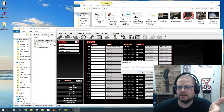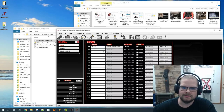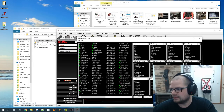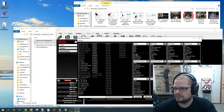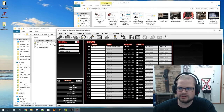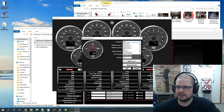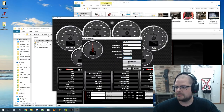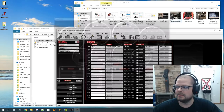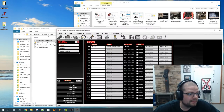Once you save and load that tune, go to your sensors screen — you can remove something like barometric pressure and find flex fuel in the list. You can also open the live data screen and type 'flex' and set it to 100 to see flex fuel percentage displayed there. Now you're reading flex fuel data.